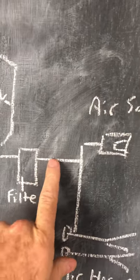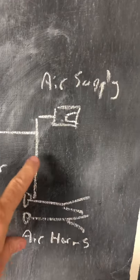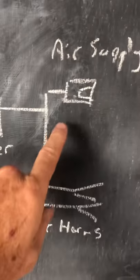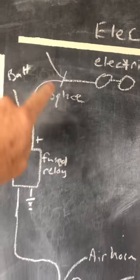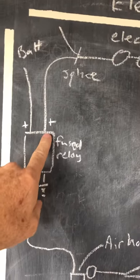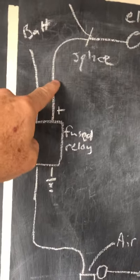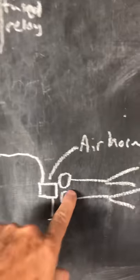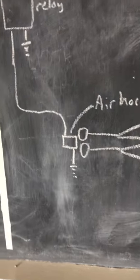After the air filter I'm going to split it up so I have an air supply external to the toolbox, an air supply at the back near where I've got the water already, and then the air supply down to the air horns. The electrical side: the loom I'm going to splice off is existing wiring coming down to the positive side of the solenoid, positive side of the battery, and earth from the solenoid. So when my electric horns are activated the solenoid will trip, powering up the solenoid and delivering air to the air horns — there'll be air to the air horns all the time because I leave the compressor on, and the air tank will be aired up as well.